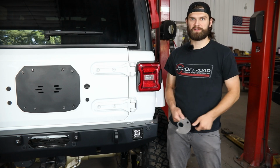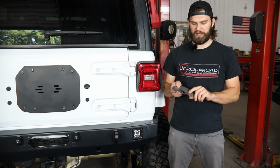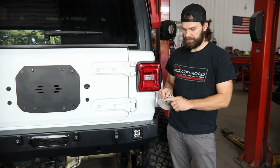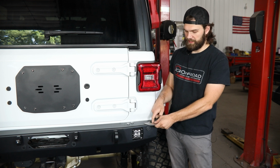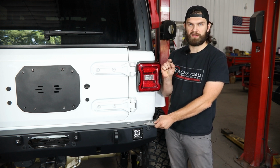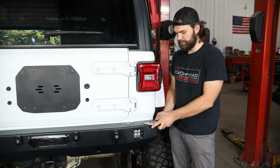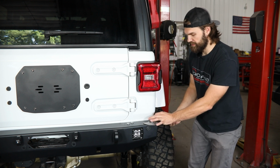Next, over here at the spindle sleeve, you're going to want to grab a pin track. Now these are going to be etched on the back side, left and right, so pay attention to that. Make sure the countersink faces up, and then it's going to line up with the hole here as well as the 2 mounting holes, and install with these small 1/4" flathead Allen bolts on the top side and a serrated flange nut from the inside.